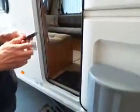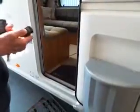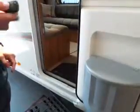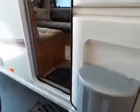It has also got an alarm. So these are the alarm fobs. What you've got on the alarm fob is a torch. This is the top button. To set the alarm is the second button down. So all you do is press it once, one beep on. You see the side markers also come on. Press it again, 2 beeps, it's off. This will also switch the awning light on and off via the fob.